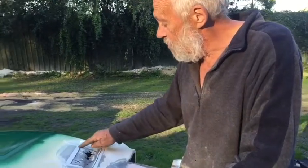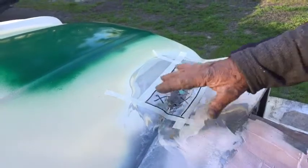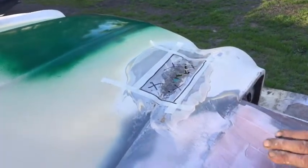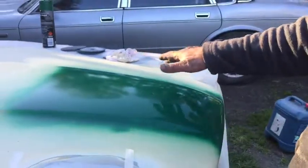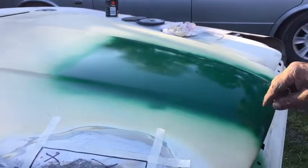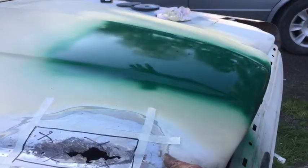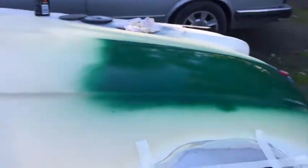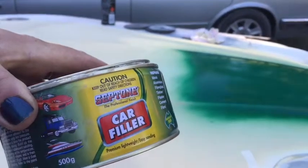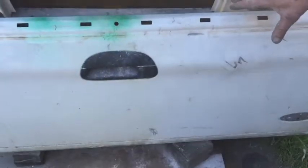So I'm going to do this tomorrow — I'm going to cut this rust out. It's a big hole as you can see. Cut that out, shape up a panel, put it in. Eventually this is going to be painted green, the same as the green jag. I just tried a bit of paint on here with the repair to see where it comes up, because I put a lot of body filler on — spray primer and body filler. That's the light body filler, and eventually this is going to be fitted in somehow.